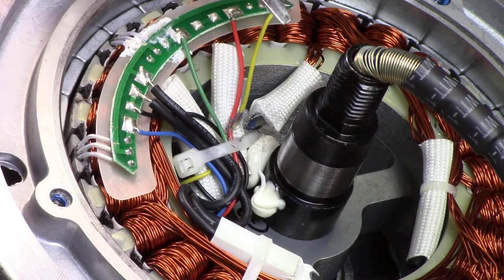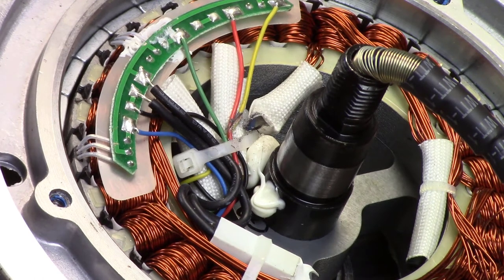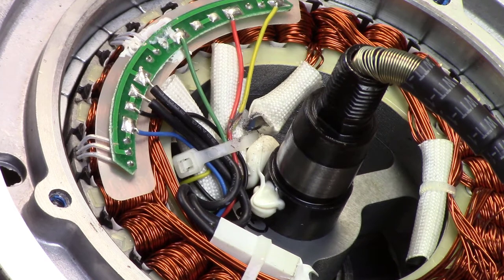And my guess is maybe there's a little bit of an imperfection in the flatness of that hub. And as it rotates around, there's one spot there where it just stays shorted all the time. And when you get the wheel in that exact spot where it's shorting those two together, the controller automatically says, hey, this is wrong. And it shuts it off. And that's why we had the dead spot. And when you're not in that spot, it's not shorted right then. But as it rotates, it shorts it out as it's turning.